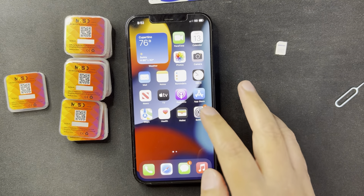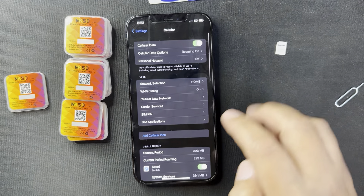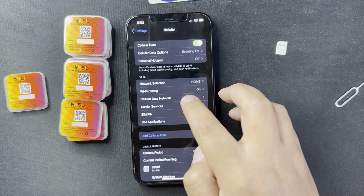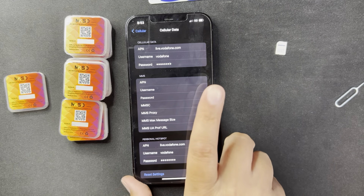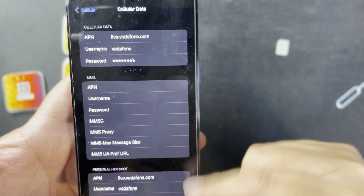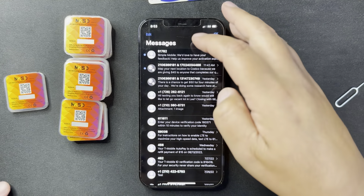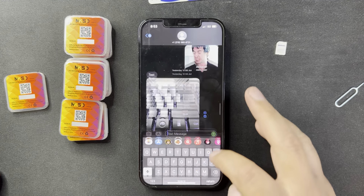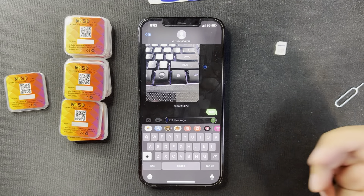Here's where most people are making the mistake. If your iPhone allows you to edit your cellular data network, this is where you're going to put your APNs for your carrier. This one comes by default but you can change it for whatever carrier. Let me send a test — Simple Mobile is receiving, so it seems fine. But let me test further — if it doesn't allow me to send a message, I'm going to change the APNs.